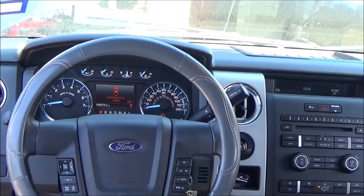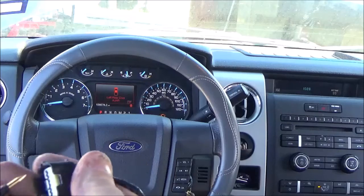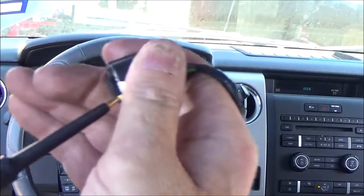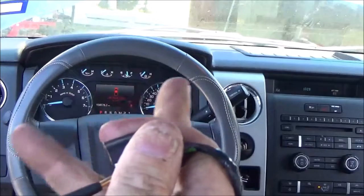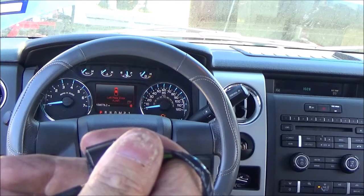So what we're going to do, we're going to find our wire that has the 10 volts, which is the green one, second one from over. We got about 11 volts. Now I'm going to hit my power probe to ground, and our light indicator should go off.